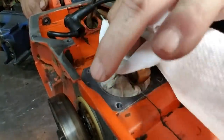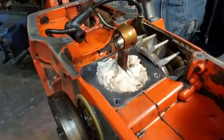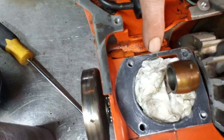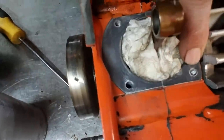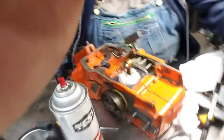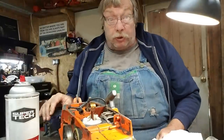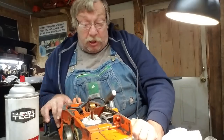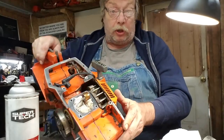Just before assembly, I do this all over again. I make sure it's real clean because you get a little debris you're not counting on. Anywhere that there were machine marks — right here — that tells you where your joints are around your bolt holes. Now you ought to see these bolt holes when somebody's over-torqued them — they're puckered way up. If they're puckered way up and you try to put that back together without fixing it, it's up a few thousandths — five, six, seven thousand sometimes.